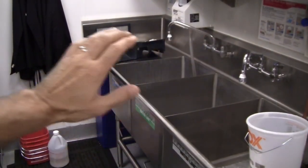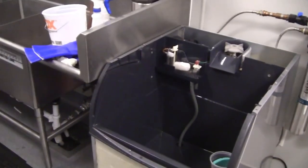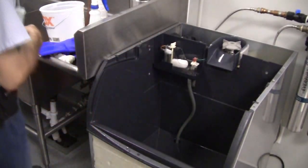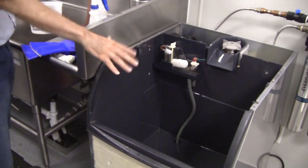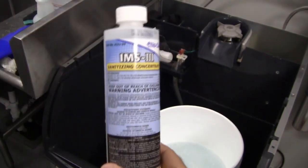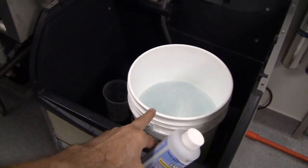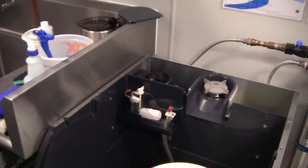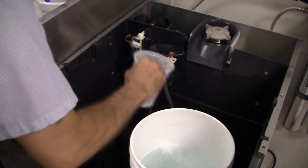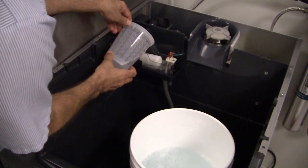I'm going to take the cover over there and rinse it under the sink, making sure the electrical connection is dry. Now that we're done with the acid cleaning, I'll take some clean water and rinse out everything. They wanted me to mix the sanitizing concentrate — four ounces of this to 2.5 gallons of water, which I've done. I'm going to take this sanitizing solution and put it inside the reservoir — 100% — to sanitize the inside of the machine.